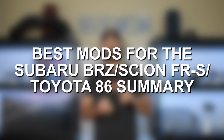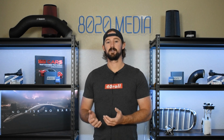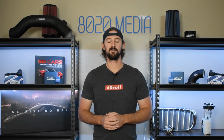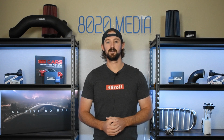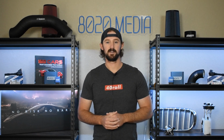Ultimately, between an intake and exhaust, headers, and tuning, those are the only 4 modifications you need to buy, because E85 is free. You will be less than $2,000 into modifications on your BRZ, and you'll get a solid 50 plus wheel horsepower out of this, which, like I mentioned earlier, on a 2,700 pound car is a lot more than it is on any other car that's significantly heavier than that.